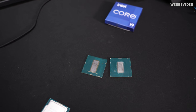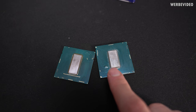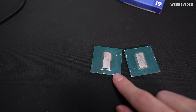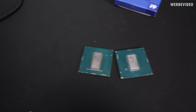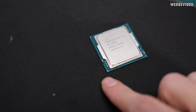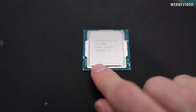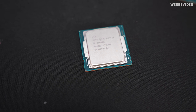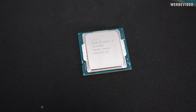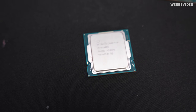Time to get to the more interesting but more challenging part — delidding the 11900K. For comparison we have a 9900K and 10900K here. The 10900K has a larger die but overall both are simple with no components in the way. Whereas on the 11900K, the bottom left and bottom right corners each have a line of capacitors, and there's also an additional line of caps or resistors underneath. The only way to delid it is to slightly push the IHS in one direction and then move it back to use metal fatigue.